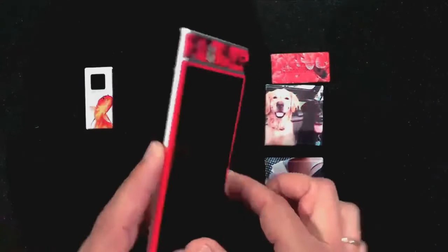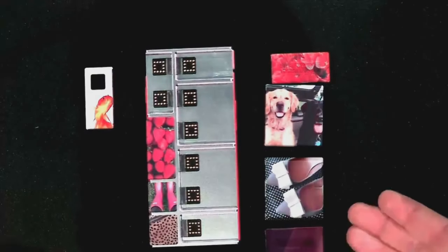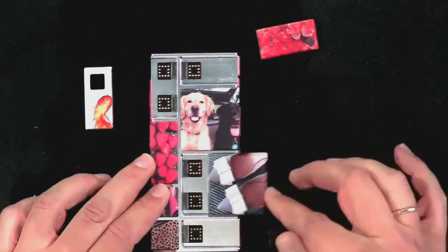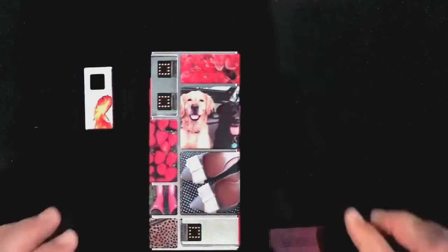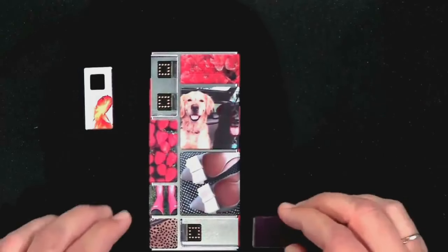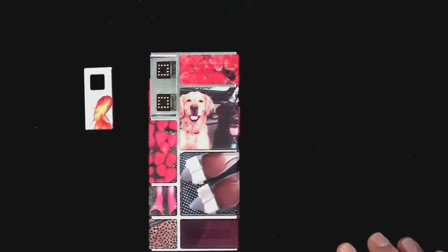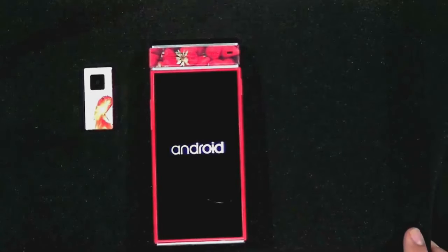This is the frame — we call it the endo — and these are modules. This is an application processor. I just connected the battery, that's a speaker, and this is another speaker. I want my Ara in stereo today. Enabling all of this is what we believe to be the first UniPro switch network, and running it all is Greybus.